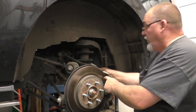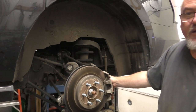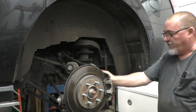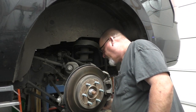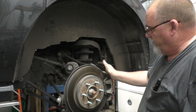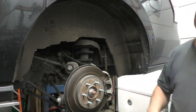Now these rear pads are virtually gone. The rear is going to be a tad bit different because they have an electronic e-brake — an electronic parking brake on it. So we'll have to have an 8 millimeter for the rear caliper itself. And honestly, I don't remember what the rest of it is. I don't know that we necessarily need to remove the caliper bracket — probably no cleaning necessary other than the slides themselves. You're going to put hardware anyway. So we're going to get the 8 millimeter and loosen that up.